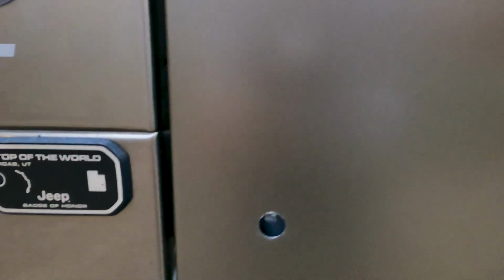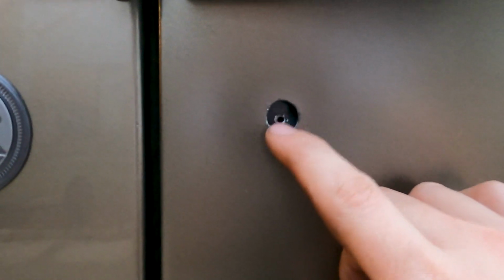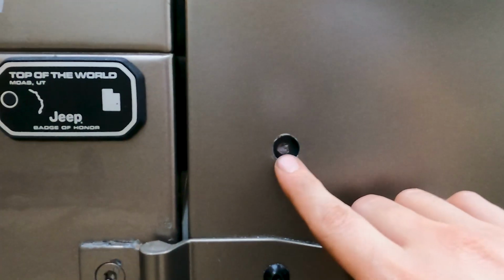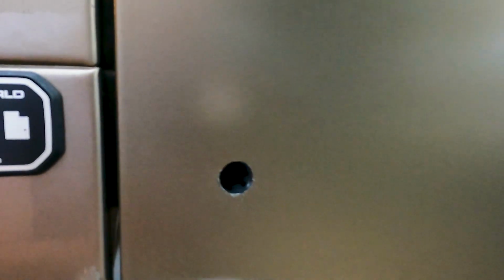One other thing I noticed is right here on these two holes, you have that second wall in there. And I don't know if that's going to be deep enough to fit that rivnut in there. So yeah, and that's what broke my first little bit. It jumped through and grabbed in there and snapped it. So that mystery's solved. The lengths I am going to avoid driving like 10 minutes up the road to buy a new drill bit is insane.